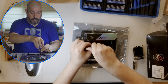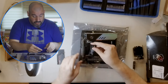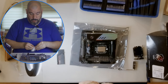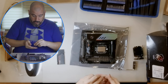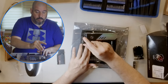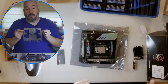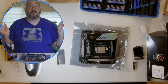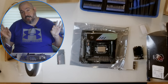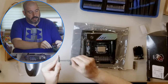I'm going to attempt to transfer my boot drive from the old computer to this one. This does sometimes work. I'm going from AMD to Intel, so there's a question about drivers, but Windows these days is smart enough to detect a hardware change, go to generalized drivers, and allow you to boot up and then reinstall the correct drivers. I've unlicensed DaVinci Resolve just in case. That does open up driver incompatibility problems later, but honestly I just don't want to reinstall everything — that's why most people skip a clean install.